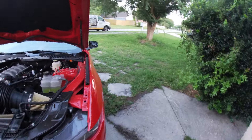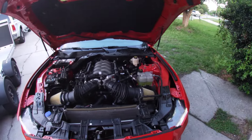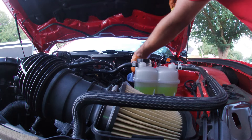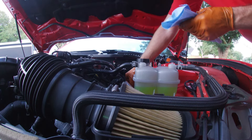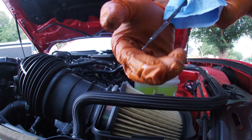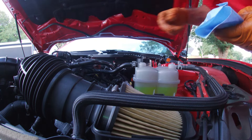Now we're going to get the car off the ramps so we can get an accurate oil level measurement. We've got the car on level ground — we idled the car, got some oil temperature in there, it got up to about 160 degrees, then shut it off. Now we're going to check the oil level. Pull the dipstick out, wipe it clean. 10 quarts puts us right at the top of the cross hatching, so we are good on oil level. You can barely see the oil on the stick — it's that clean.